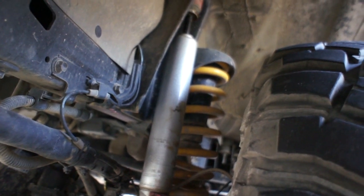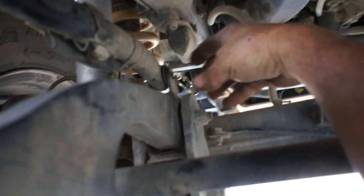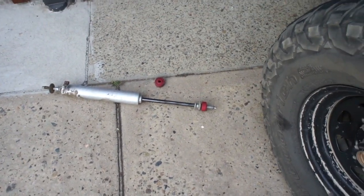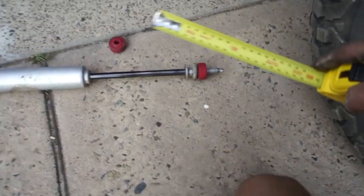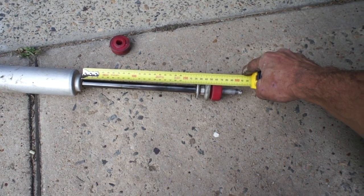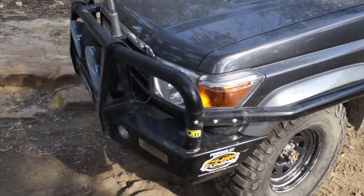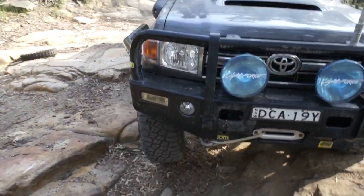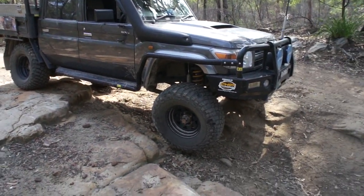I think I've gone a little bit more, so there'll be a bit more shaft on the new ones that are coming. We're just doing this here at home to make it easier for when we go out bush and test it. We've undone the bolt and we're just going to temporarily replace it with a linchpin - just a couple of linchpins I had floating around. The other measurement I'm going to need for this experiment, when we're out in the bush to see how much shaft we've got - if we can remember that one, it's 220 mil - so when we flex it up we'll see if we're using all that shaft. That's its new pretend ride height. First we'll take a measurement: 130 mil of shaft.